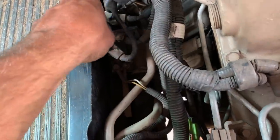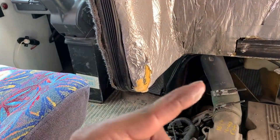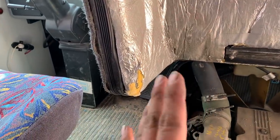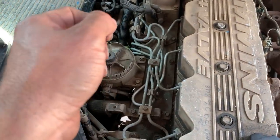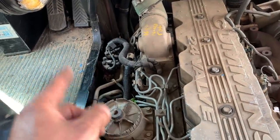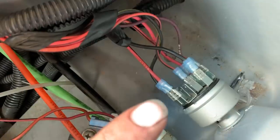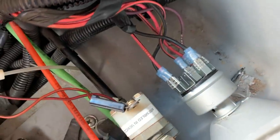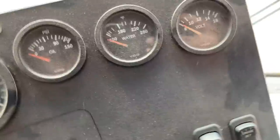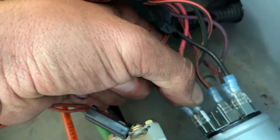Okay, it's acting different. When I had the last starter in here, I'd turn the key on and when I turned it to start I'd lose voltage really fast — like a huge high-amperage load. This time I'm not having that. So what did I forget to hook up? It's acting like the starter's not even on there. Maybe the relay. I looked at a wiring diagram online and figured out where I need to put all the wires. Let's see.